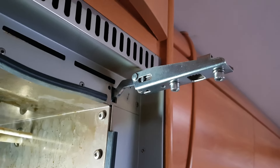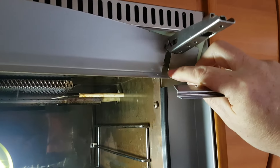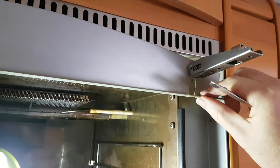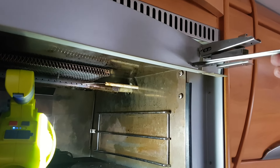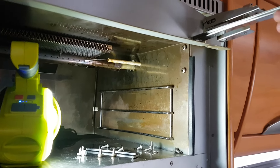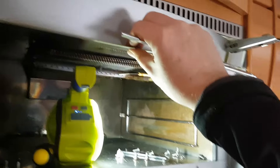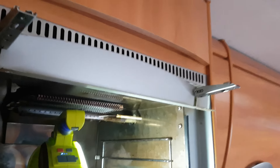Now the hinges are secured. Next thing is to slot this curved piece over — this is your last chance to do this because it's got a slot here that slots over the lug on the hinge. Once we start bolting things together you don't get a chance to slot this over, so make sure this is on first. Then we're going to put the glass clamps on with some Allen keys. I replaced the Torx screws with Allen bolts. So these are the glass clamps — and then hopefully the oven door can slide on and bolt to this plate. Back in a few minutes.